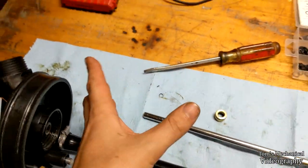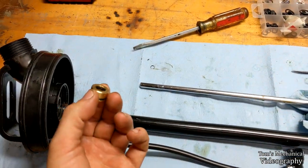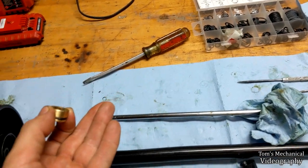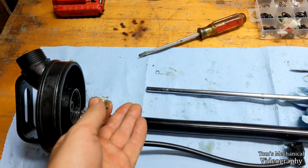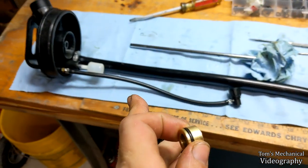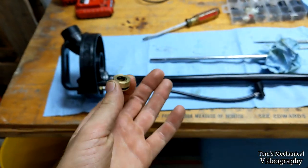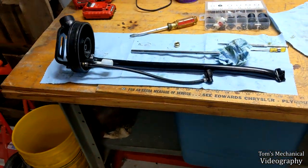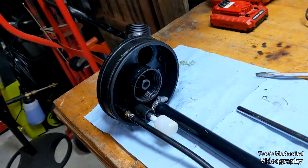I used the golden rule of thumb for o-rings: you just put it on there and beat it until it self-clearances - which, don't ever do that, but I'm doing it because I have tons of o-rings, it's cheap, it's 10 at night on a Sunday, and I'm not going to go find another o-ring tonight. I've self-clearanced this one and it seems to seal just fine. This will let me put it all back together and test whether that was actually my problem. If so, I'll just run it until it fails again and then get the proper o-ring.